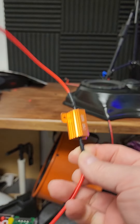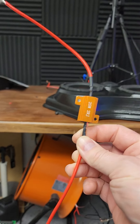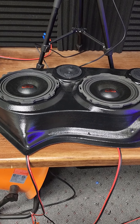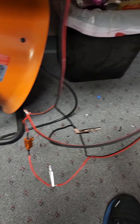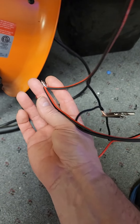One more thing we will talk about today is the resistor. This is a 25-watt two-ohm power resistor that comes in the wiring kits we sell at Custom Speaker Lots. The purpose of the two-ohm resistor is to provide an additional two ohms to your two-ohm parallel load. So you have two ohms from the parallel speakers and then in series you add an additional two ohms. This one is wired into the positive side — wires from speaker one and speaker two come through the resistor, then negative back directly to the head unit, creating a four-ohm load that the head unit will see, thus keeping it safe.